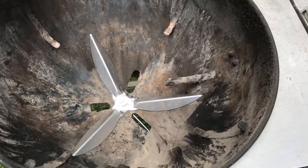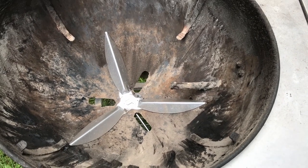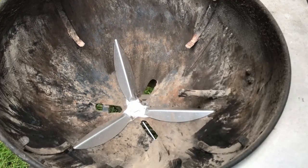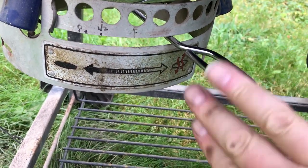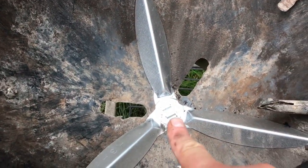The installation of the new is pretty straightforward. I was able to snake my fingers up through one of the vent holes and hold the three vanes in place, and with my thumb hold the plate underneath in place. What wasn't apparent from the instructions was that you install this handle upside down, and when you rotate it 180 degrees, the tab goes from the bottom to the top and it locks the plate on the underside snug up against the plate on the top.